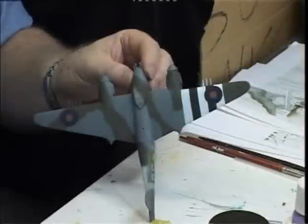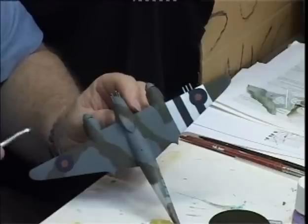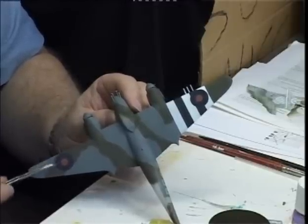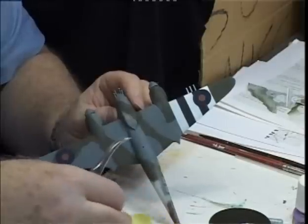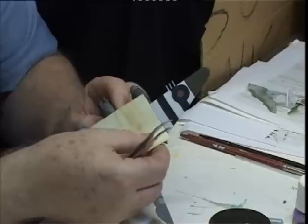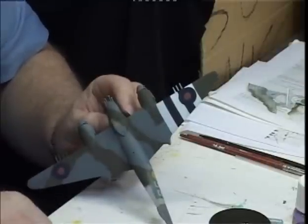Any alterations or corrections can be made easily that way. It is better to do it with remasking than to attempt to do it with a hand brush. Hand brushes tend to make a difference in the surface shine that you get, and you certainly can't do a uniform straight edge. It is much easier, for instance, to go back in and simply mask an edge and then overspray any loose errors that have occurred.